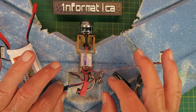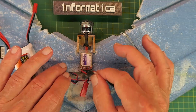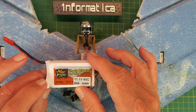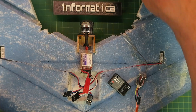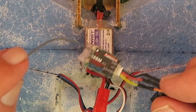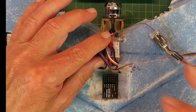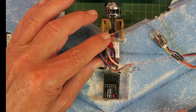The setup of the wing is very basic. All you have are the two left and right elevon servos, the ESC which provides the BEC function as well, and that's powered by this little 600 milliampere ZOP Power LiPo. Very impressed with that little battery. In its previous configuration this flew for nearly 10 minutes, even longer on a gentle throttle. I'm using the same receiver — this is a tiny RadioLink R8SM — and of course our Hobby Eagle A3 Mini. It's going to sit in there quite comfortably, just below the depth of the pre-cut tray.